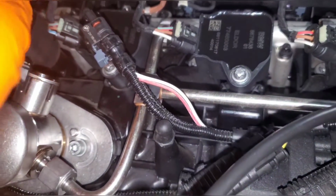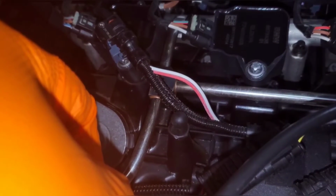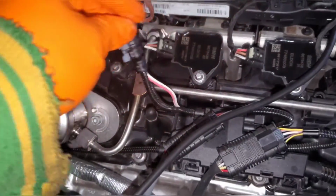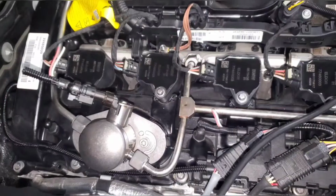And now what you're going to do is cut the wire. I want to cut it in line with this post, so right around here, and that way it'll give you enough room to work, and you can still access it easily to crimp everything, but you'll also have enough length of wire because you will need to strip it back a bit for it to actually be attached. And whether you're soldering or crimping or whatever, you just want enough room to actually get in there and work. If you see, this is all the wire you get, so not a whole lot to work with. But yeah, cut the wire, cut the sheathing at about the same spot, strip the wires back, and then prepare to extend it.